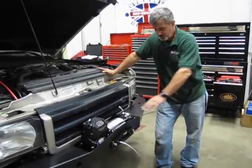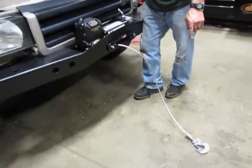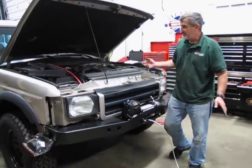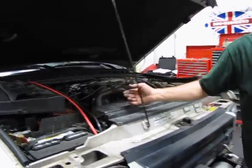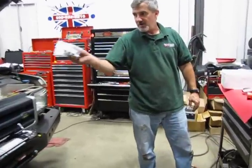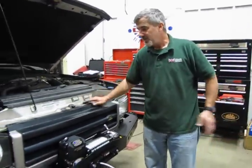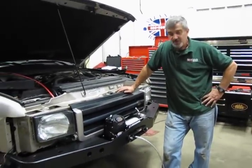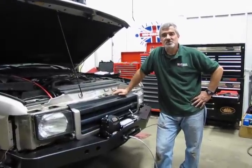We now have the winch in place with the faceplate on and cable pulled out. With just a pin you can install the hook clip. Regardless of the winch type, the basic hookup is the same — follow the directions, it's a simple connection to the positive and negative side of your battery. Some will also include a relay pack that installs on the positive side of the battery. Once that's done, plug in, you have your controls, and you're set to use your winch. When you're ready to mount a winch on your new steel bumpers, call any of our knowledgeable salesmen at 1-800-533-2210. Thanks for watching.